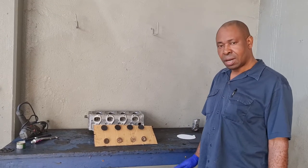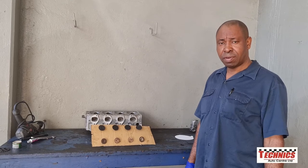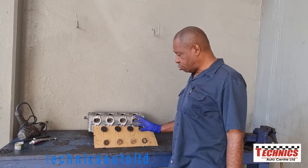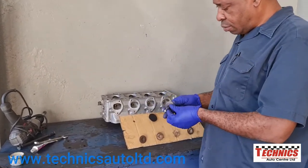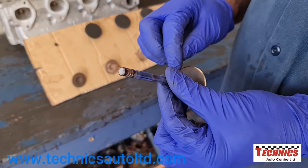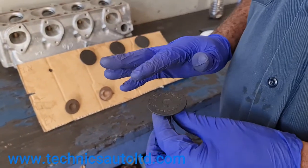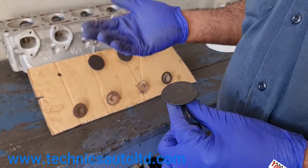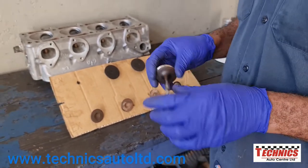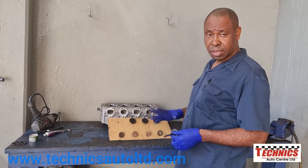Now I'm going to clean the carbon from the valve and get them ready for grinding - that means reface the valve seat and the valve face. Cleaning the valve is a little bit tricky because we just want to take the carbon from the ear areas but we don't want to damage the face or the valve stem. You don't want to use too coarse a cleaning tool or sandpaper because you don't want to damage the valve. We're going to use maybe 80 grade sandpaper, then 120, and give it a first cleaning and see how they come out.